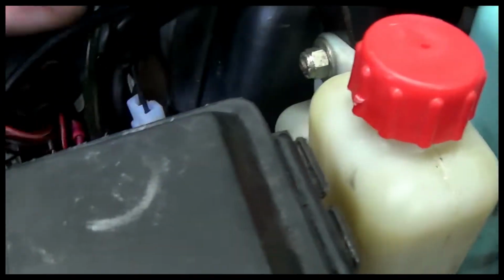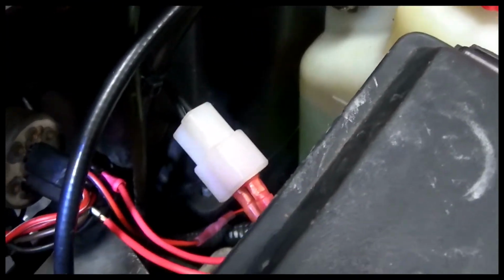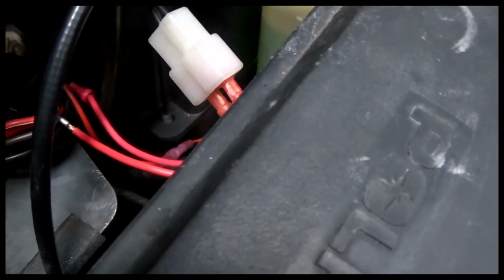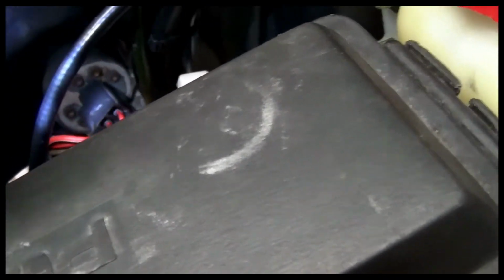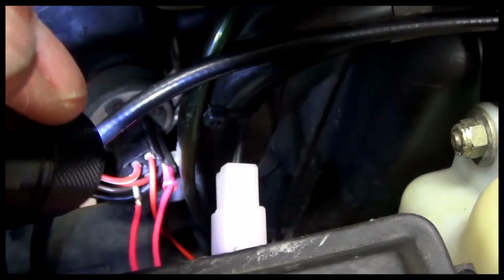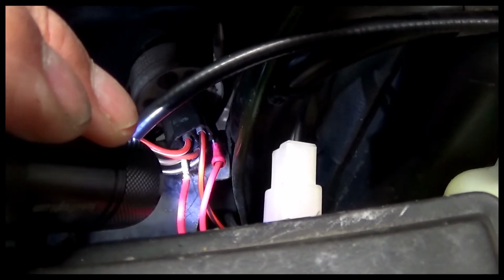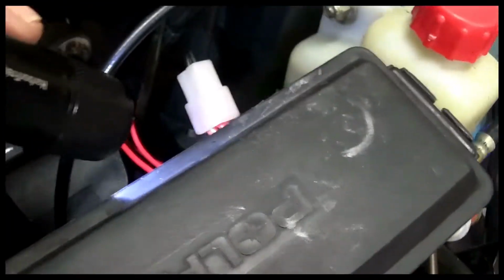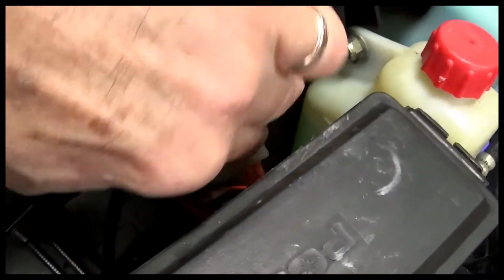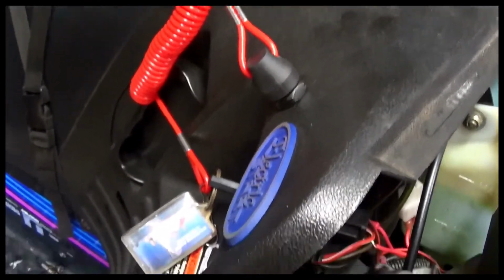This is the plug for the tether. This is what came with it. Holding that flashlight in my mouth. It had two spots and had a plug, and this was bought for a Polaris, but apparently doesn't fit this one because there's no plug-in to put it in. So I ran two wires off of that. I put one wire into the black. Looking at it, you look through the camera here, and then one wire, you can see it's kind of bare right there, the insulation broke off of it, but anyway, that goes into the brown wire. And so that's how I hooked that up, and just wire tied everything in place with some wire ties and started it up, and it works.